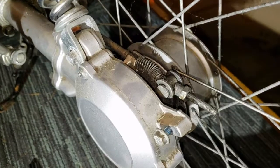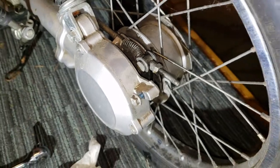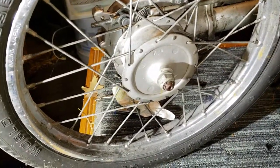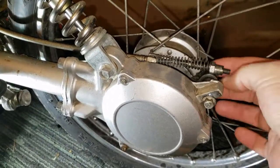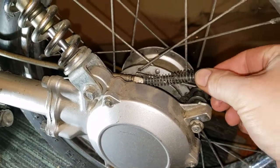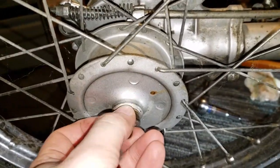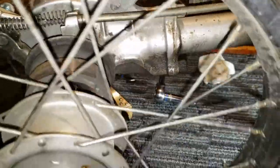The next thing we're going to do is loosen that tension bolt on the brake cable so we take all the tension off the brakes — I'm not sure there is any because the brakes aren't working. Then we'll be able to come over here and get to that wheel nut. I got the brake cable loosened up and pulled it through the brake lever, then reattached the nut back onto it. Over on the other side I cracked that loose and pulled the nut and washer off, and then the tire should come off.